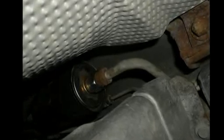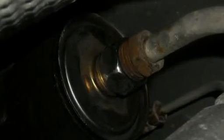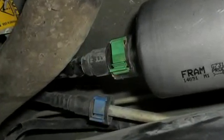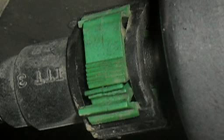I strongly recommend that you break this nut apart here and do all your draining of pressure on this side prior to popping off this quick disconnect fitting. That'll reduce the chance of getting a heavy splash in the face. Here's the quick disconnect close up.